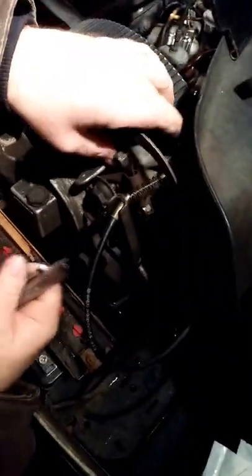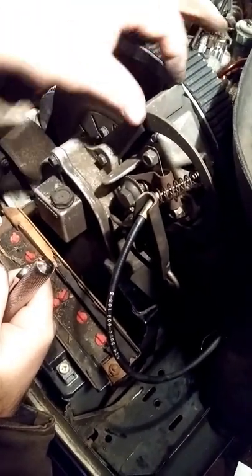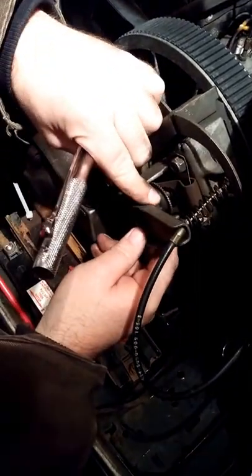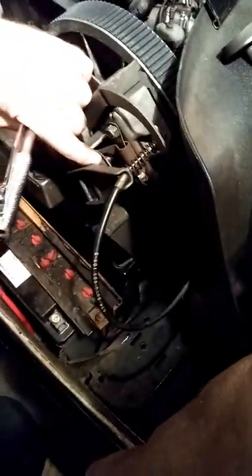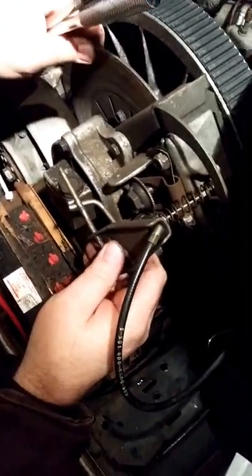That mount is solid. This thing just slides in there — you hook it over the disc and then get the mount on there, tighten up the bolts. We'll put our little system back together, which is when you squeeze it, it puts pressure on the two pads, and that'll squeeze them together and stop the disc.